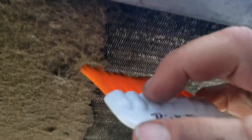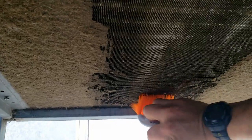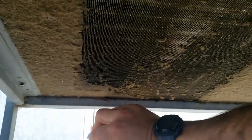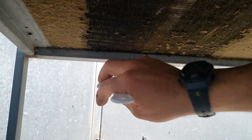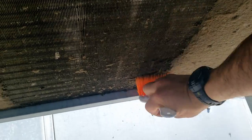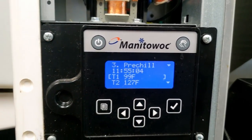Got a fancy new brush and it does a wonderful good job. Let's get this thing cleaned up and then go down there and see how it does. What's weird is this would not have caused that board to do that odd thing — no reason for that to say it's making ice when it's not and not run the compressor. I still think this would cause some issues but not the issue we got. Anyhow, we cleaned it up and it looks like we dropped some ice because we're pre-chilling already.